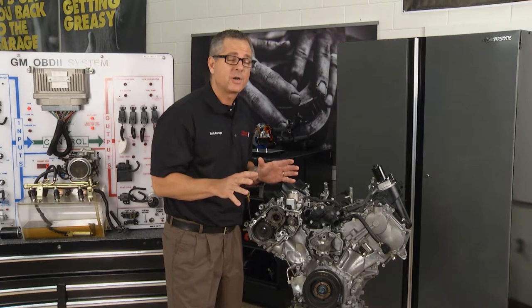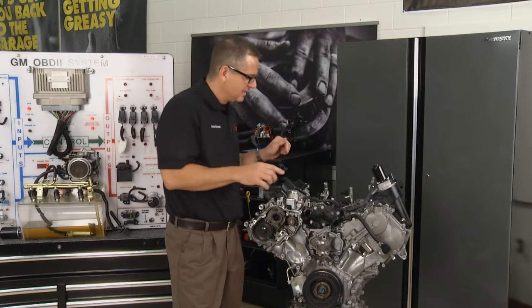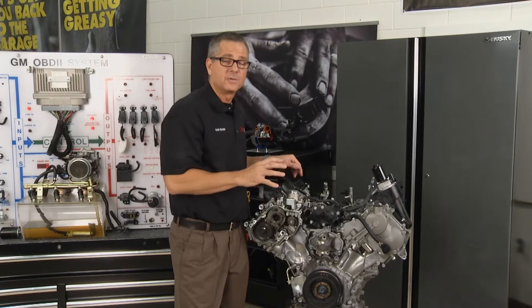But there are a couple of safety precautions. After this point, 1,500 to 3,000 psi of fuel pressure is dangerous. Make sure you know what you're working with. Check your service manual, check your specifications, and look up how to depressurize the system so nothing happens to you if you work on any of these fuel lines.